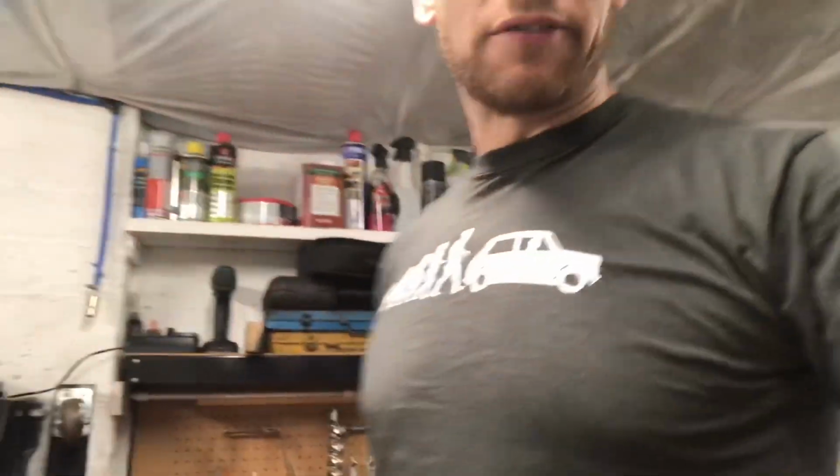So I basically went off the same dimensions as a standard fuel tank, so standard depth back into the front subframe. It's about half the height, so really it shouldn't interfere at all with the suspension that runs in behind. Turns out that when Z Cars went into liquidation and then got bought out again, they changed the shock supplier. So now they use adjustable gas shocks on the front, and unfortunately they're slightly wider than the standard shocks you used to use on a kit. So it fouls the standard fuel tank and therefore my fuel tank.